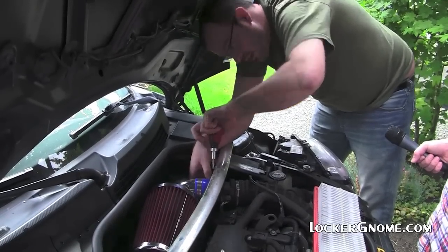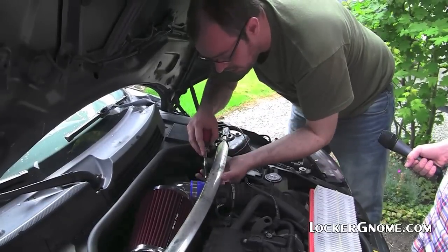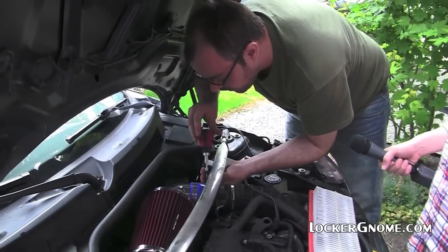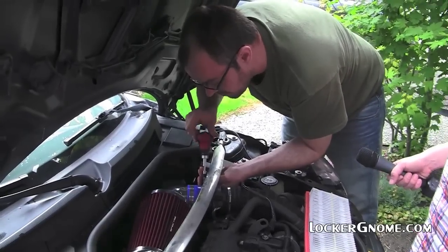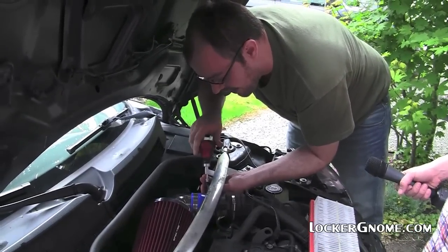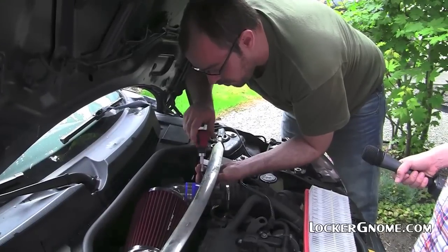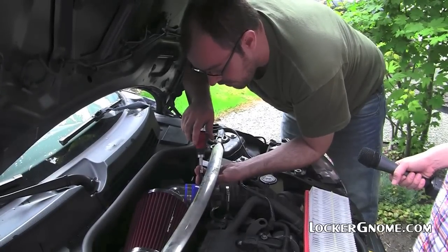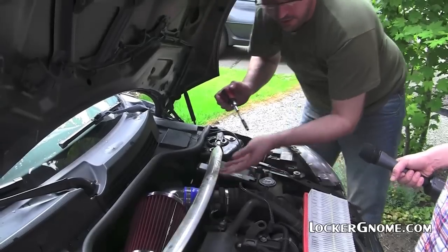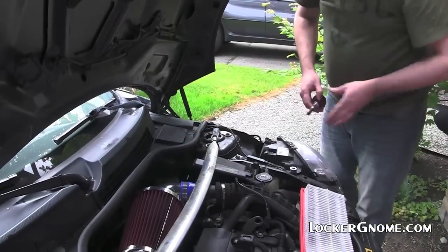Yes. Everything from a 66 Mustang to a Jeep Wrangler to just about every car I have, I upgrade the air filter. It's a $40 upgrade in most cases, and it's usually good for 3 to 5% on a naturally aspirated car in terms of miles per gallon. And so that's now in place.